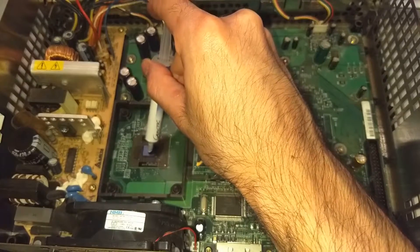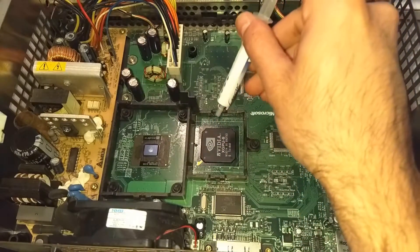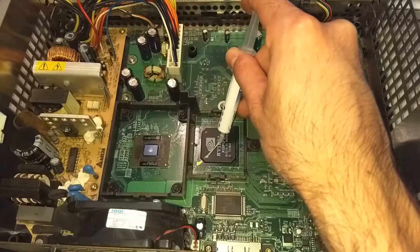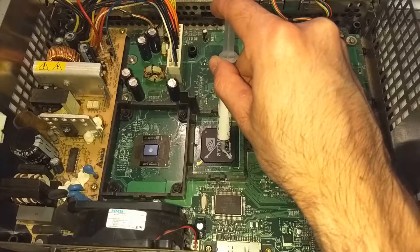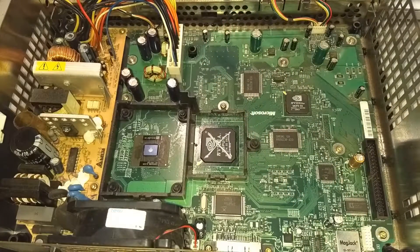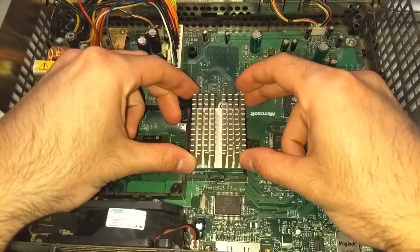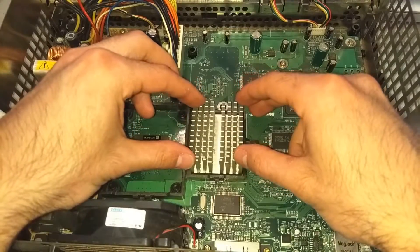Since the GPU is a lot larger, you're going to have to use a little bit more thermal paste. I'm always worried about proper coverage, so for the larger chip I like to do the cross method — you could also use a larger dab in the very middle, same as the first one. It really doesn't matter what method you choose as long as there's a very good layer of paste. I drag the tube slowly across an X pattern. I don't really fret about the proper amount — it's much more likely that you use too little and suffer overheating problems than put too much, which in my experience has never been a detriment.